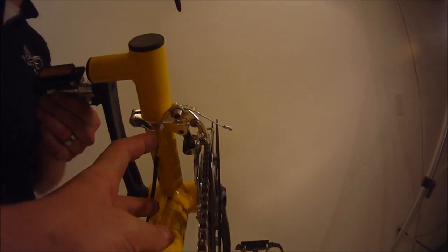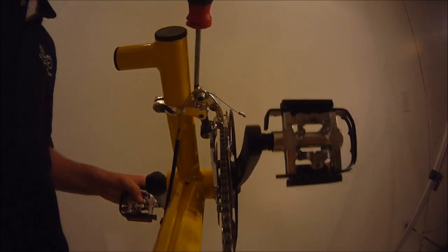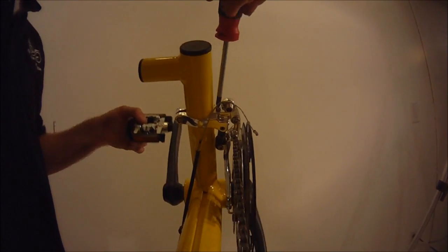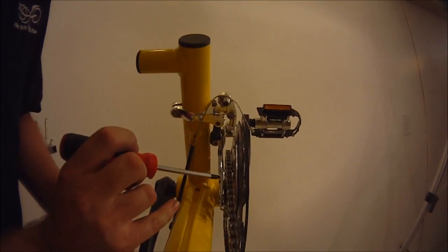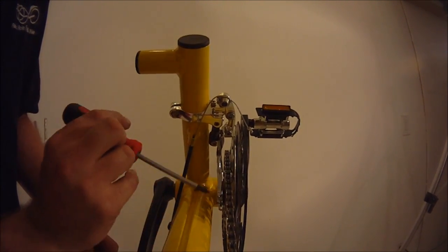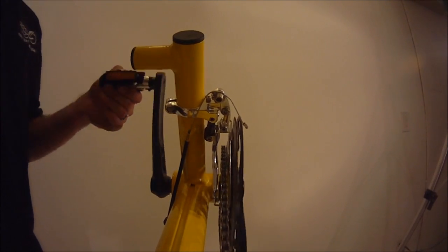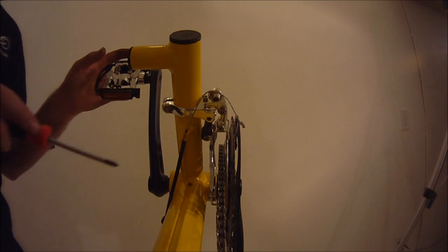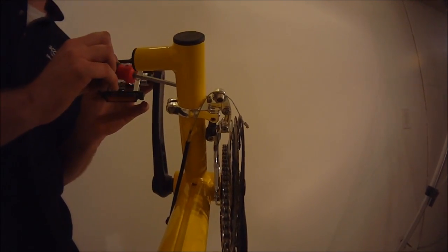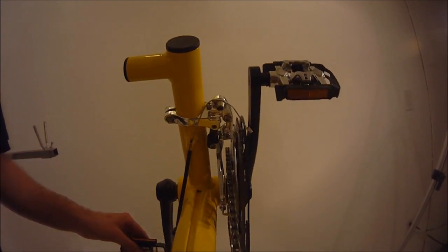This one's easy to figure out, because you can just keep pedaling and then release this screw as you're pedaling until it goes down into first, and the chain isn't making contact with the derailleur on either side. So the chain isn't touching here, and there's a space between here as well. So as you do that, you've got a quiet chain line, nothing's making any sound, nothing's touching anywhere, and you've tuned your front derailleur. So that's pretty much it on your derailleurs.